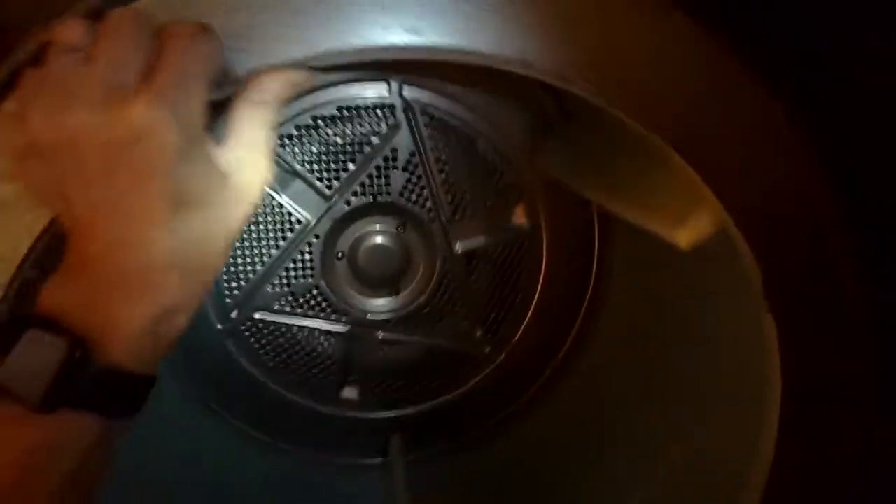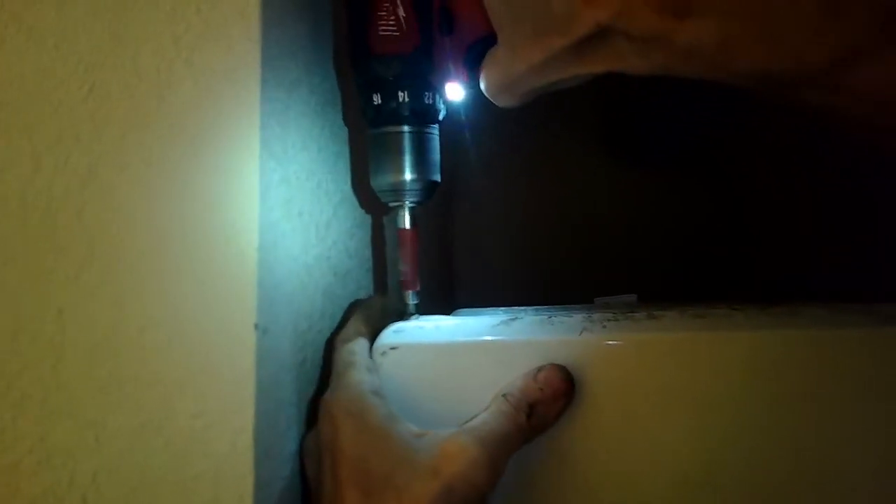So far the repair is not too difficult. Putting the front panel on is a little challenging because you have to line up a bunch of stuff. You want to just take your time — maybe get someone to help you do it too. I'm putting the top panel back on, adding all the screws back in and tightening them up. I have to do that before I add the front panel back on. I'm actually standing on a stool to get high enough to put these screws on because the machine is pretty tall. I'm going to add this little black piece back to the top panel near the front — that's used to help keep the tumbler from moving forward. And now I'm ready to add the front panel back on, slowly get it into position, and try to get the upper lip of that front panel to go above the top panel. Then I'm going to add all those screws back in. That's the hard part.